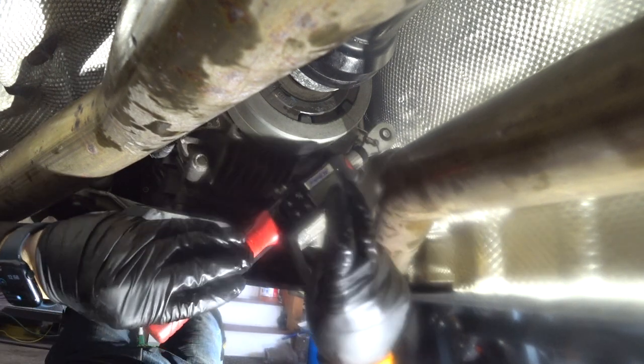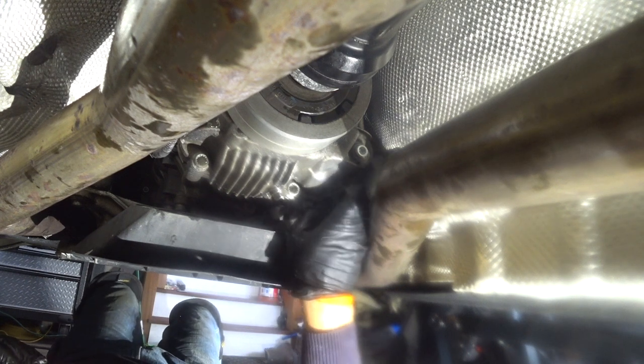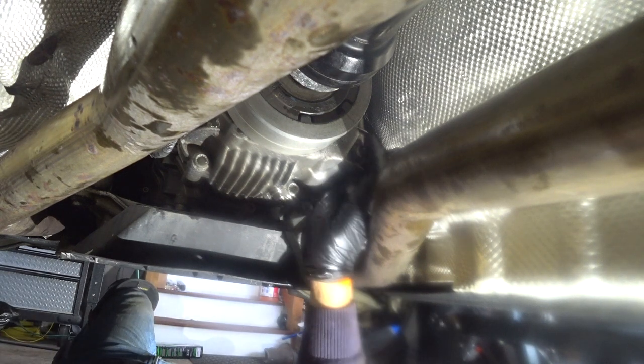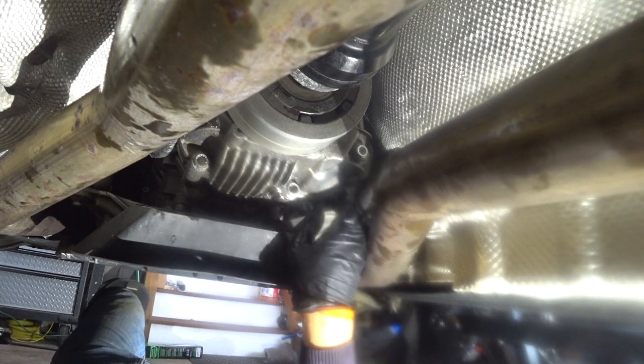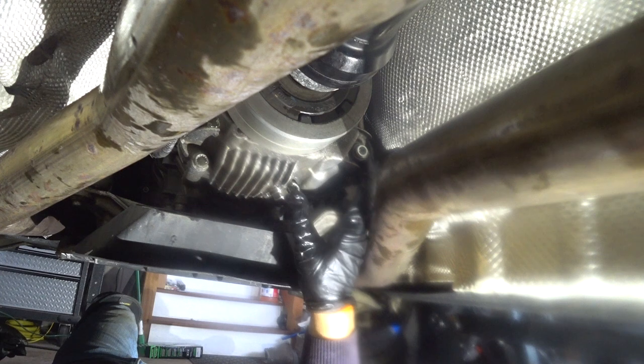Because it's not recording any torque, going to 20 newton meters is not a good idea. I mean, I went to almost 20 newton meters here and it was hard. This one here didn't even record a torque, and it's like halfway in, so I'm going to leave it like that. It should work okay, and it should not apply any significant stresses to the hole here.